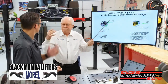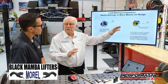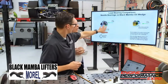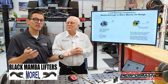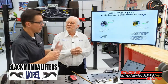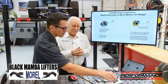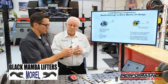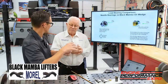All these parts are rebuildable. This gives you a good comparison because you can see visually — this is not a lot of load-bearing area with needles, but there's quite a bit more load-bearing area with the bushing. For street applications, when you're running a lot of seat pressure because you've got big valve springs in a giant engine with heavy parts, it makes better sense to have a bushing lifter that can hold that load. That wheel diameter is also nice for the camshaft to have more control and less dynamics.